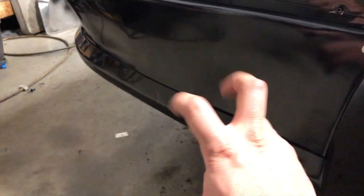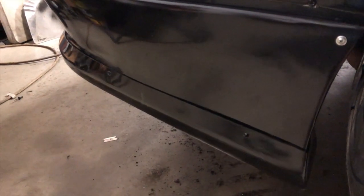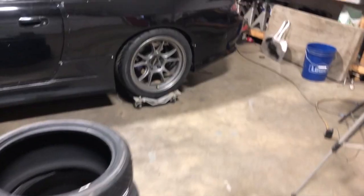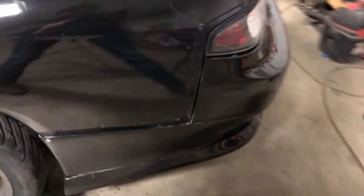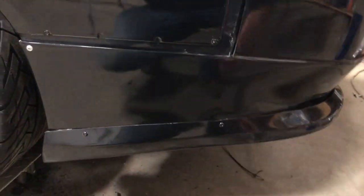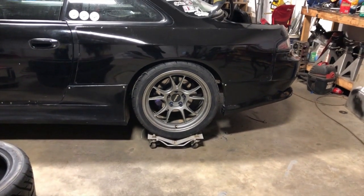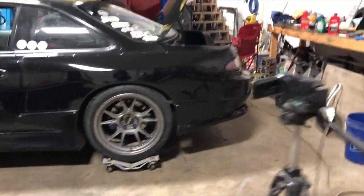I've painted these quarter panels myself. Painted the rear bumper too. The rear bumper is kind of neat — I actually cut the lip area off and shifted the whole thing up about an inch and a half. On the old bumper I only picked up the front, cut it on the body line, and made the total length about ten and a half inches, then riveted it back together. It didn't look bad, but it made the bumper a bit square. I felt like this upswept look was more in line with current trends — it has kind of an OE-plus look, somewhere between OE and something like GP Sports.